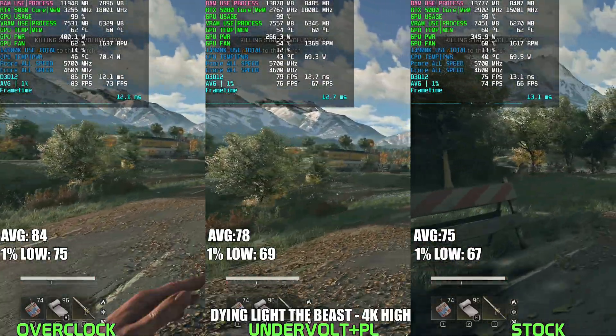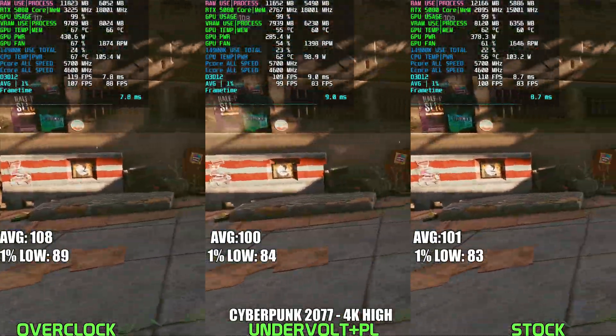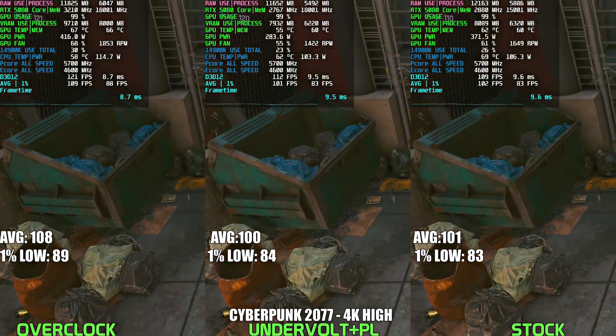So here's where I landed. The RTX 5080 Expert doesn't need 350W to deliver its stock performance. With an 85% power limit, 870mV at 2900MHz, and a healthy memory overclock, I was able to shave off about 70-80W in real games while matching or occasionally beating stock performance. In Dying Light the Beast and Cyberpunk 2077, I saw power drop from 350-370W down to 270-280W with the same FPS. In Chronos and KCD2, performance was basically identical but way more efficient. In Black Ops 6 at 4K low, power fell to 180-220W versus 250-280W stock with no performance loss. That's lower temps, quieter fans, less room heat, and potentially a cheaper PSU footprint without giving up any frames — and I think that's quite remarkable.